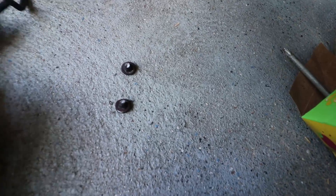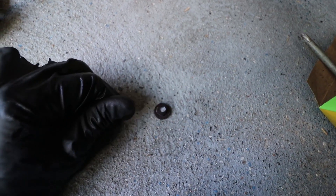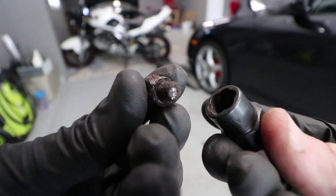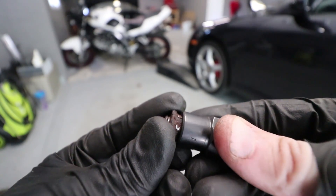Unfortunately, but rather not surprisingly, both bolts sheared right off. I'm going to have to go get new fasteners from the hardware store — keep this in mind if you're working on your car. This car hasn't even seen salt, but even cars in California seem to have this issue. It's worth noting I had to use a nut extractor to break the bolts off because when I went to use a regular socket the nut rounded anyway. I'll put a link in the description below for where you can get one.